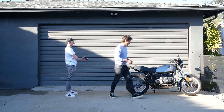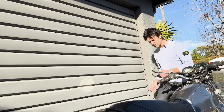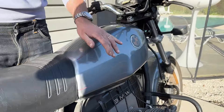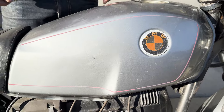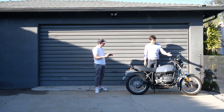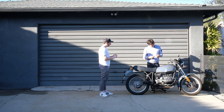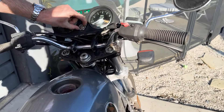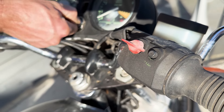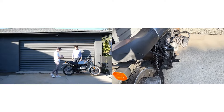It's not demolishing it, it's basically giving her a second life. No one wanted this bike — the fuel line isn't hooked up, it obviously had a different tank on it because it's got a dual fuel line and this has a single outlet on the gas tank. It doesn't have a gas cap, so the gas is probably mouldy in there. There's no battery. Not even the original key or nut on the ignition barrel. Let's see if it's a three-clicker — two clicks, so it's GS.